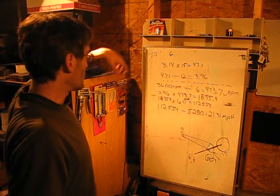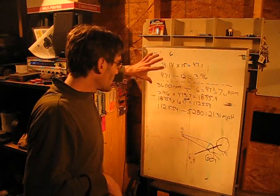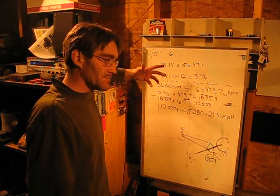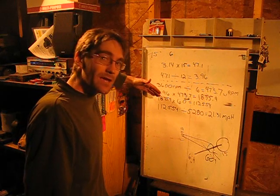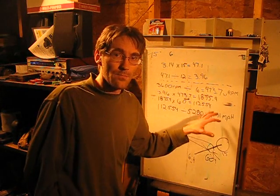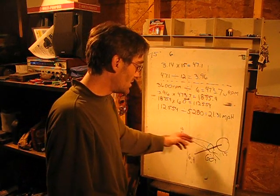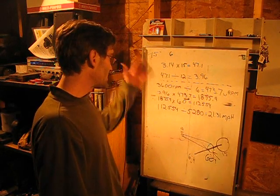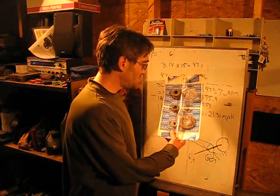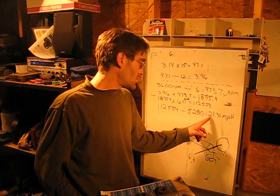When it comes to having a torque converter, you'd be operating with two different ratios and I'll do a video on that later showing how to do that calculation. It's the same calculation — it's just that you'll have a high end and a low end, so it involves more different calculations. So that's how you figure out how fast you'll go. If I were to use this jack shaft setup and my 15-inch tires, I know I will be going about 21.3 miles an hour.